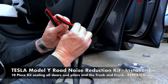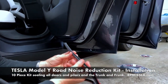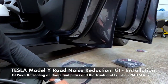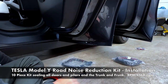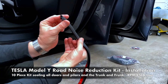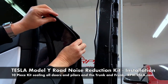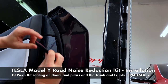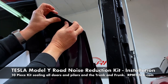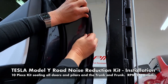The right side of the car, the passenger side, think of it like this. When you get to the bottom of the car, and this is against the car, you want this to seal as it's hanging down, so you wouldn't want water to accumulate in it. So we always say, start here like this, and imagine that this is gonna close when the door closes, pinch the open-ended extrusion. So we suggest you start at the top. Stick it on so it's not hanging over the edge. You don't wanna see it. Start inside the lip, just like this, run it all the way down.